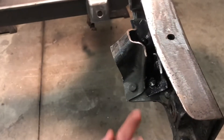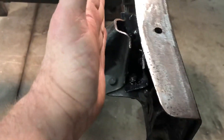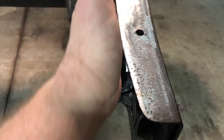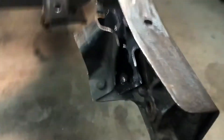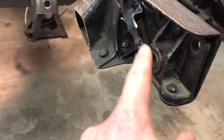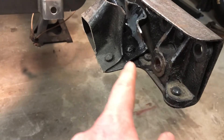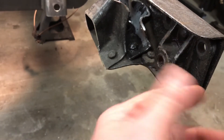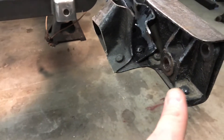What I'm going to do now is go from underneath, take the saber saw, and basically cut a little bit outside of the bottom of the frame line, then grind it down to level with the top frame piece. I think I'm going to have to take out these leaf spring mounts as well. I'm almost certain, so I'm going to go ahead and grind off the tops of those too — pop them out. Nothing's really easy, but it'll clean up the frame as well.